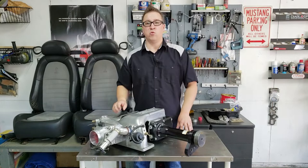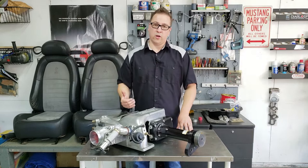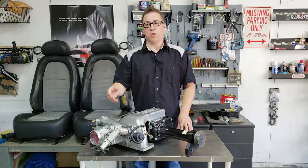Our inlet manifold comes in two different sizes. We have the standard inlet, which is quite small, and then we have the larger Flowzilla — this is the one I have here. That can accept up to a 90-millimeter throttle body housing, and that's a distinctive difference. It lets in way more air, allows higher boost levels, higher power production. You'll notice on this side we see the Fox-style throttle body. You either have to convert to a Fox-style throttle body or supply your own elbow, but be warned: if your elbow is smaller than your inlet, you're going to have a flow restriction and the blower is not going to perform as well.